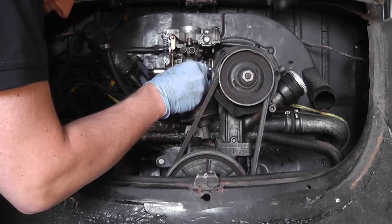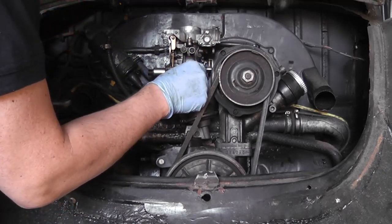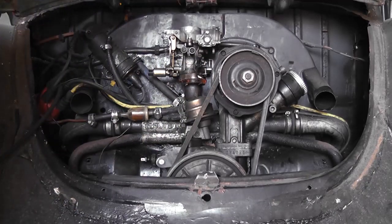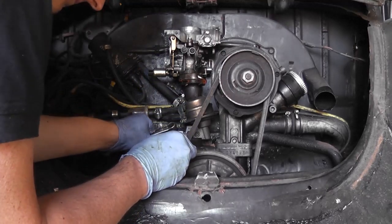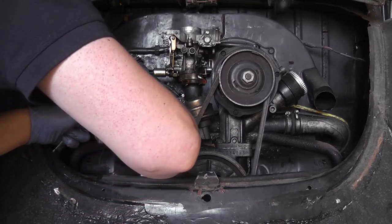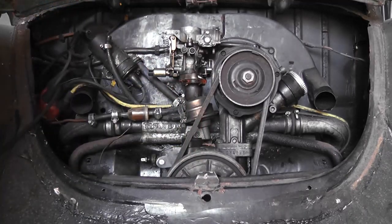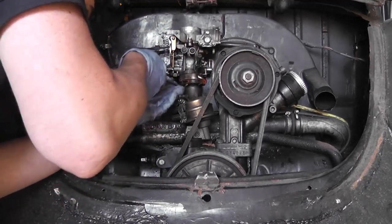This looks like it is the manifold from a van rather than a car, and the reason I know that is because there's a take-off for the vacuum servo. So yeah, that will maybe be something we might address — to be honest with you, if it's working though we might just leave it be. If we can get one though, so much the better. I was thinking those heat riser tubes look a bit bigger as well — maybe they are bigger in a van.